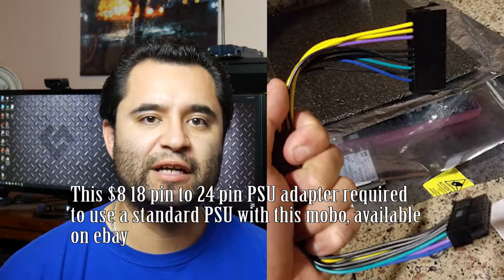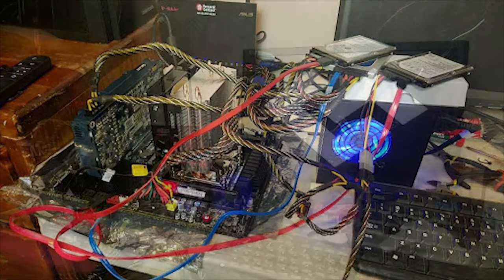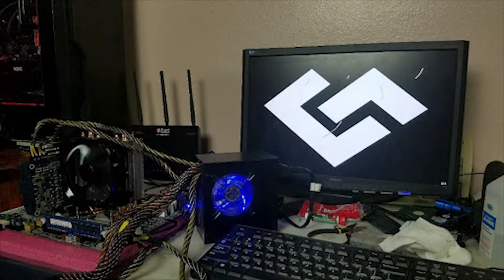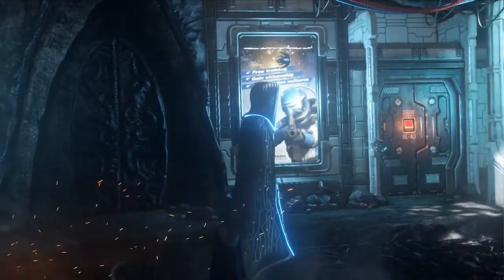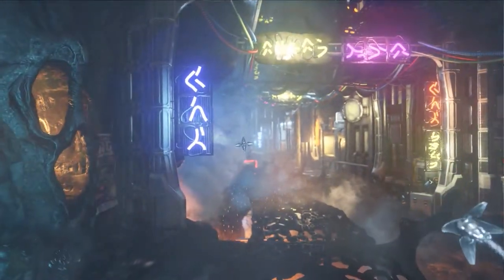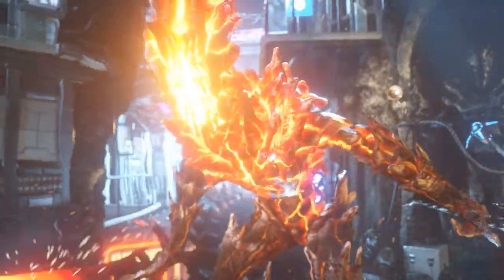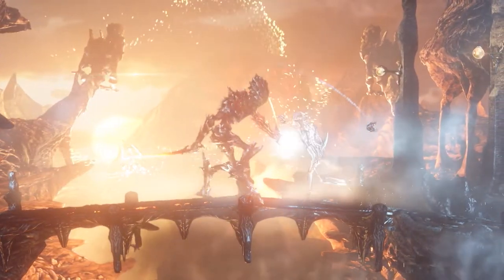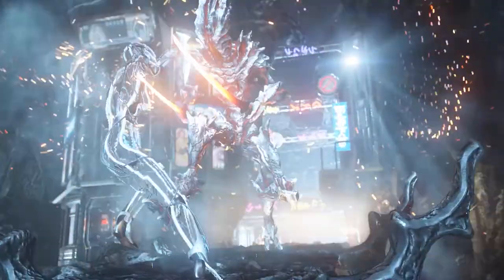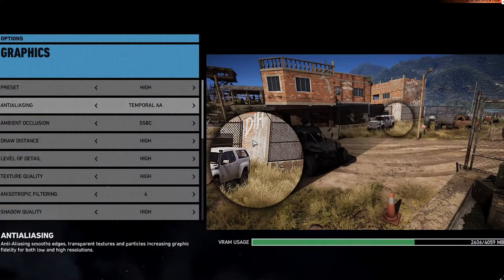My honest review of that: there's a little issue having to do with the sense pins on the board that detect some factory stuff HP motherboards check for. It causes an F1-to-boot error no matter what. I was able to snuff those out on the Z400 x58 build I did, but it's a little more complicated on the Z620/Z420 build and I won't be able to snuff those out, unfortunately.